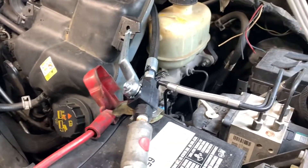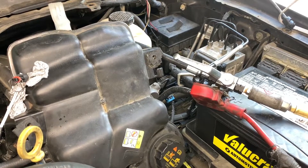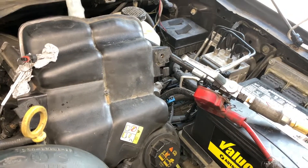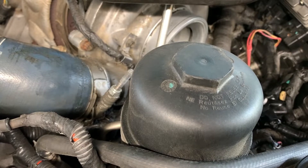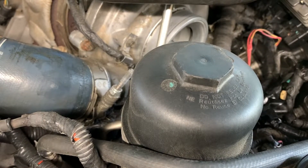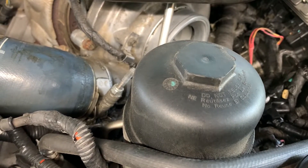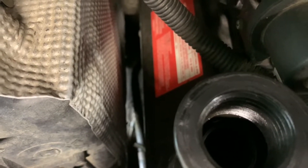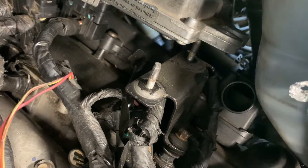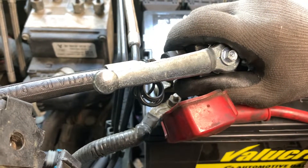Sometimes it takes a minute. So I've had my air on it for at least 10 minutes now, it's got 160 pounds sitting on it. I've not heard the first bit of air. This is a no-start hot, so I did let the truck idle for a good 10-15 minutes before I started work on it — I got it warm because I wanted the oil to be warm to see about the leak. But as you can see, I have no air sound coming out of the oil fill, nothing coming out of my crankcase vent, I don't hear anything. The little bit that you hear is right here at this joint — I hear nothing else.